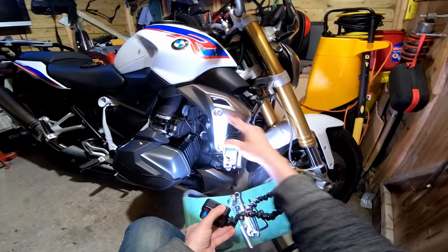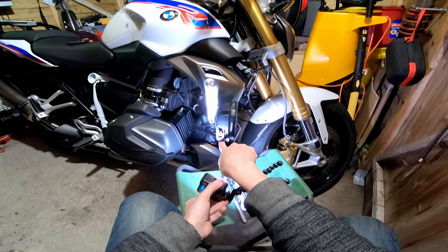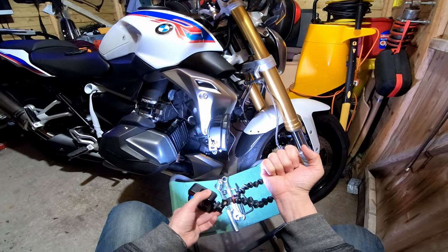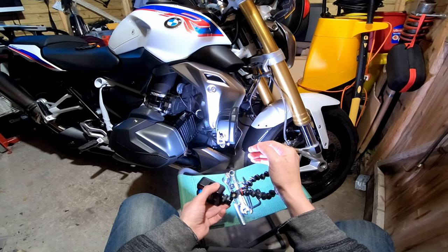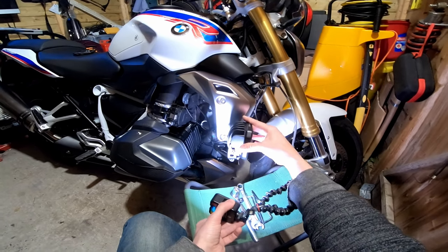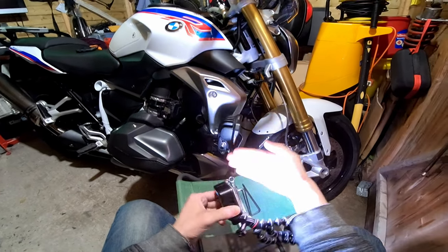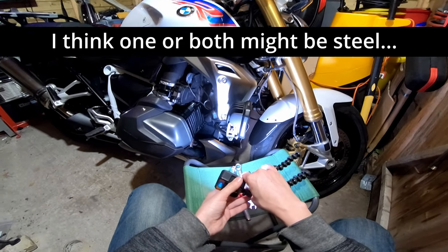It's just, there's no grip there. And I've tightened that as much as I reasonably can with my hands, and you know, that's a fair bit of torque going on there. And I don't want to strip threads off these bolts. I think if I get the powder coating off, get the anodizing off, get bare alloy to bare alloy on that mount, things would be a lot grippier.